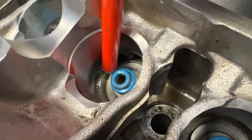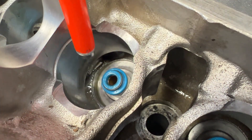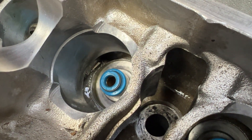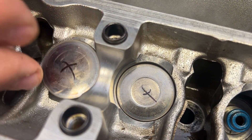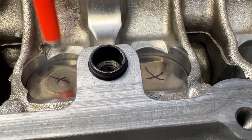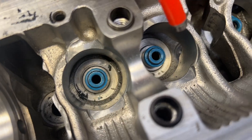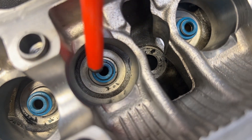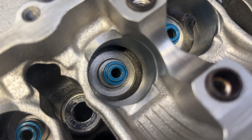I know it's going to be hard to see this, but you see this area right here. The bucket goes into this hole and it can hit this little ledge that's right next to the spring pocket. Now it's a casting, so that little piece is going to be different on every head. You'll see here how they're different heights. The best way to look at it is how we did the clearancing for the camshaft to the bucket — this bucket here is deeper than this bucket. On the intake side, that piece does not exist — there's nothing that it would hit. It's only on the exhaust side. I don't think that just clearancing it will fix it; I think it's still going to be a problem until he goes to a dry sump.